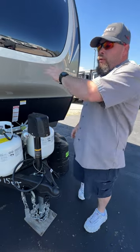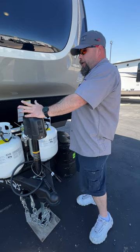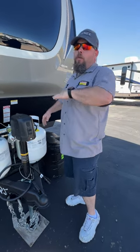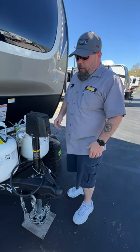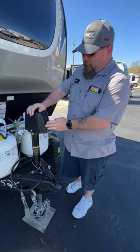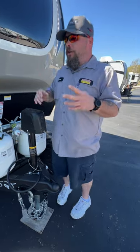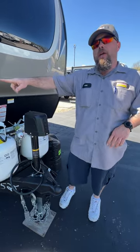Take a little carpenter's level, set it right inside the doorway lengthwise. You don't have to set some blocks down and then roll onto them — let that vehicle do the work for you. Once you've unhooked from the tow vehicle, level front to back with this guy, then you're going to lower your stabilizer jacks. Those guys are actually motorized. The switches are going to be located on the door side of the coach, and I will show you guys those.